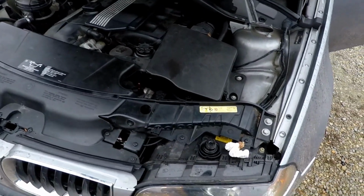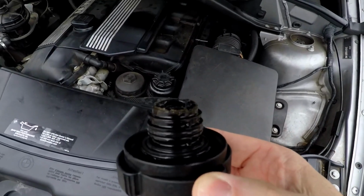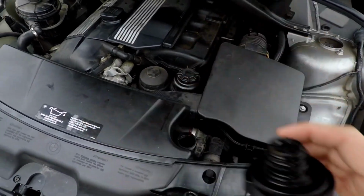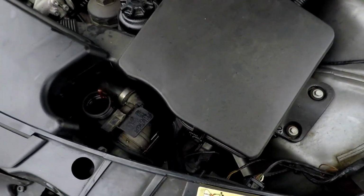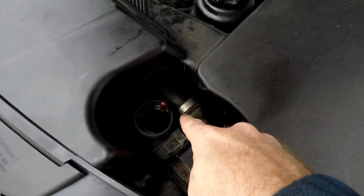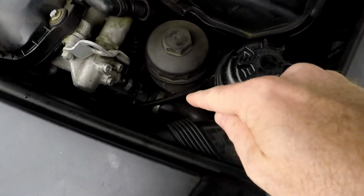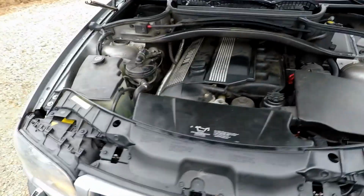So we pulled the radiator cap off, and he said this is probably the issue, or some of the issue. It's missing the little ring on top. It's actually broken off of there. So that'll make it leak on the highway. Looking at everything, the hose has been on there for a while. The clamps are actually rusted. You can see some seepage going on around that one, but look at how ballooned out that top hose is, and probably never been replaced.